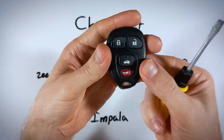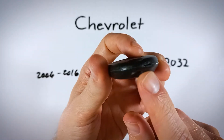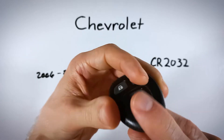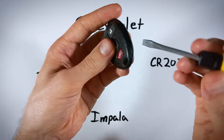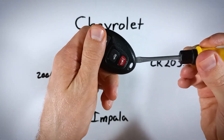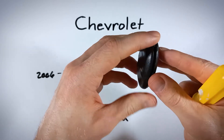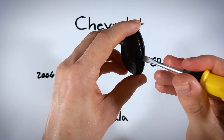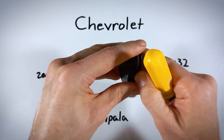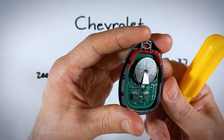Jumping right into it, you want to look on the bottom right of the device — right where the key ring attaches, right next to that, there's a little indentation. You can see it right there. Take your flathead screwdriver and insert it into that area. Once it's in there, just give it a little twist and that will start to crack open the device. From here, you can go into the opening and give it another little twist to loosen it up more, or you can just pull it apart with your fingers — whatever works for you. Just get it open so we have access to the battery.